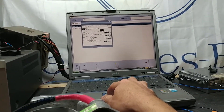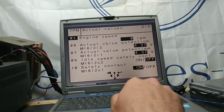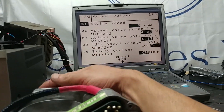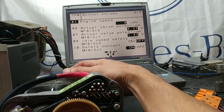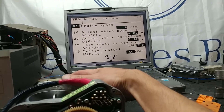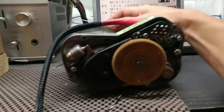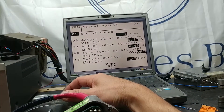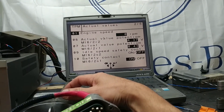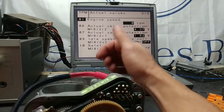Let's get the readings full screen. The readings are pretty much equal, and when I open the throttle plate, as you can see potentiometer R1 changes — because this is a mechanical linkage that goes straight onto the potentiometer. It opens and closes mechanically, and the plate follows.